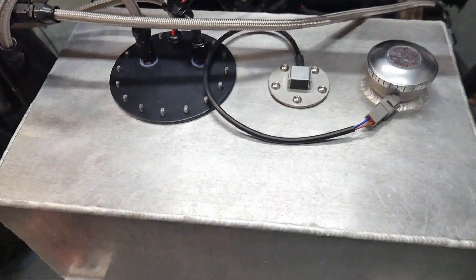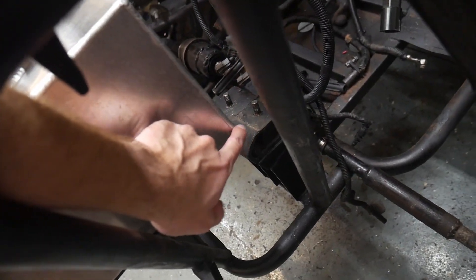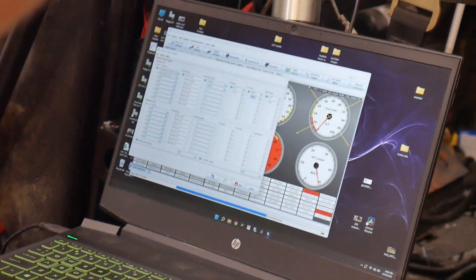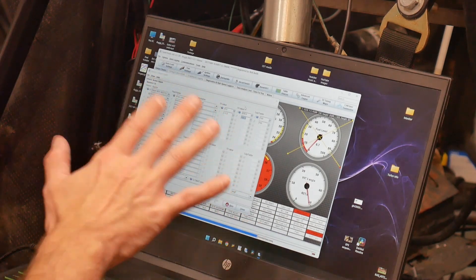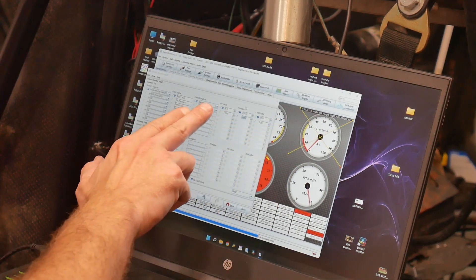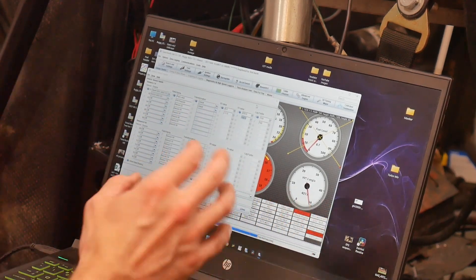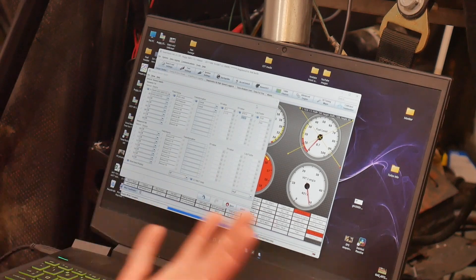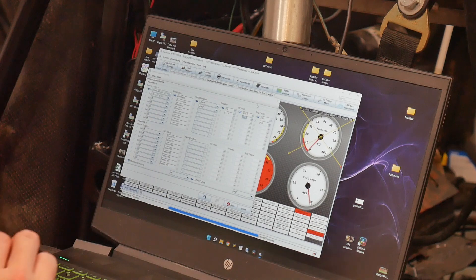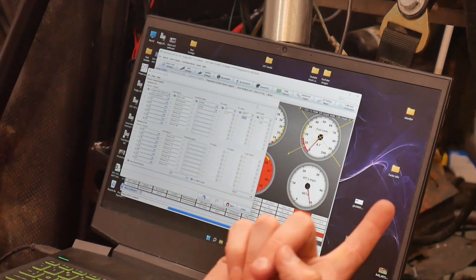I am still concerned about the amount of room I'm going to have because if you remember the previous setup, the turbo was just barely touching or just barely not touching the corner of the tank. In terms of the value — so this is reading voltage, all it's doing is reading the voltage. Basically what I'm telling the needle to do is based on what it's reading at zero volts and what it's reading at five volts. I wish this were as easy as putting zero under the zero value and a hundred under the five-volt value, but in reality it just doesn't really work that way. I'm using a zero value for zero volts, and we know that's accurate because zero to 90 ohms is what's on that particular sensor.